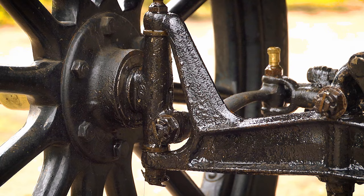Consider where the car's been used. Has the Model T been used on rallies regularly? It suggests that it's a good working car. Has the car come from a museum? Ask why it went into the museum in the first place — these cars are designed as static exhibits in many cases, designed to look good from a distance. Once you get closer up, chances are there's filler that's been used, or the car went in with a broken axle, for example. Has the car been built as a show car? Some of these cars are designed to drive on and off a trailer and be judged at shows — in that situation, they don't want to see oil everywhere, but has the car been built with the correct amount of grease and oil in all the joints, or are they going to start wearing very quickly once you use it?